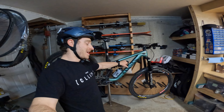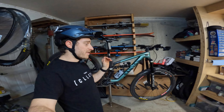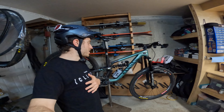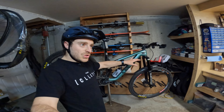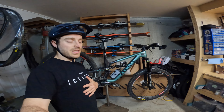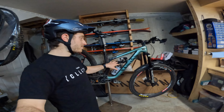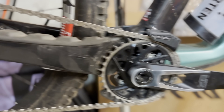The coil — I think it's a 275-pound spring, so that's pretty light, but I'm kind of a light guy. I have the high-speed compression almost fully closed, which is very different from the front to the back. The suppleness of the coil with the added damping is really cool because I find I'm not just blowing through my travel and I have a lot of good mid-stroke support. Depending on the track I'll adjust my HBO 1 or 2 clicks because I want to be able to use full travel. I know when I hit it and I don't want the HBO to kick in too much. Rebound is pretty much fully open because it's soft, it's fast — similar to what I ran previously.